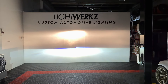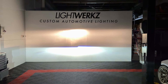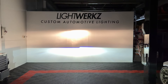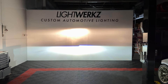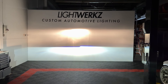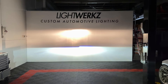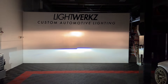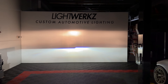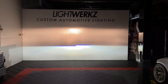The halogen, while it is bright, you're sort of left with — I don't want to say pencil beams — but it's very tight. It makes for good performance on the road but you pretty much have very little lighting to the sides, and that is a concern for some drivers. They feel like their low beams could be brighter, but really they just want a little bit better beam optimization, and the only way you're going to get that is with a projector conversion. You can see the intensity zones right underneath the cutoff on the G5 BRT, which is right where you want it.